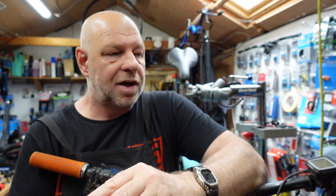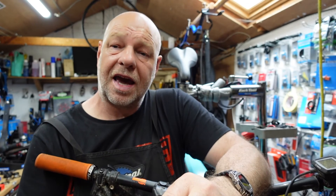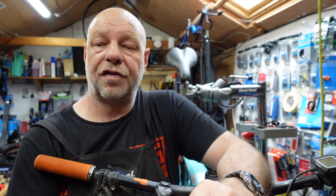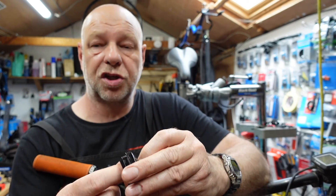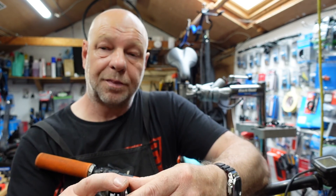I'm hoping I've tried to make things a little bit simple in terms of bearings because it can be really, really confusing. If you've got a mountain bike, generally you will have a quite common bearing — whether it's FSA or Cane Creek or anything else — the chances are they'll be these sorts of bearings. The bottom will be 51.8, 36/45 or 45/45. The top could be 45/36 or 45/45, but you can soon tell which angle you've got on your existing bearing by looking at it, and you could measure it as well. I hope that's helped you. If it has, brilliant; if it hasn't, I'm sorry, but I've done my best. You can always ask questions and make comments — if you're unsure about anything just leave a comment and I'll try and get back to you. Thanks for watching. Please subscribe and I'll catch you next time. See you later. Bye.